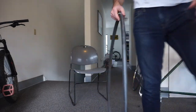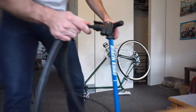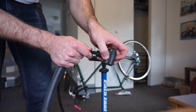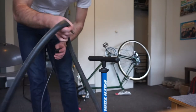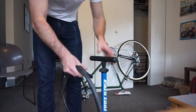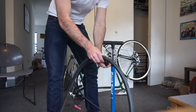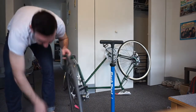What you do is come over to your pump. A pump like this has two different settings or nozzles — one for Schrader valves and one for Presta valves. It just says S and P. This more common type is called a Schrader valve. What you do is stick it in there, push this lever back, and then just give it enough air to give it shape. You can always take some out as you work. It should just look like that, opposed to a limp piece of rubber.